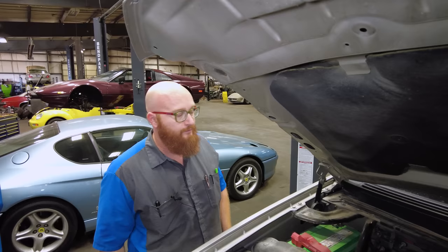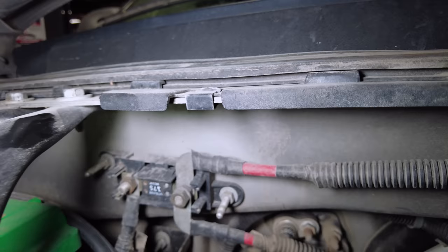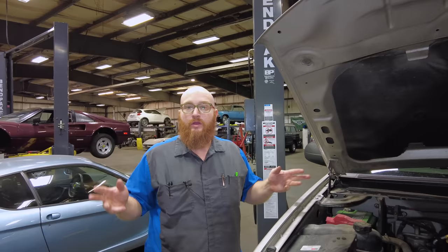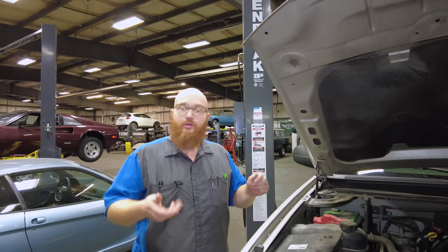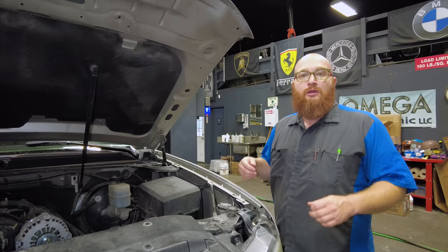The next thing is this 175 amp mega fuse. You can see it's already a little corroded on the connections. So many times a customer with an Escalade or Tahoe complains of a no-start condition — I tell them to wiggle the connections on that fuse and it starts. It's a common point for corrosion and poor connection. You have to take the nuts off, clean all connections down to shiny metal, put grease on it, and put it back together. If you had a shop do it, it'd probably be $50 or less, but you could do it yourself for free.